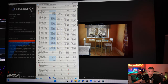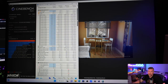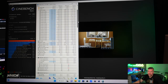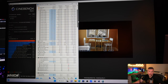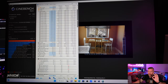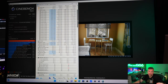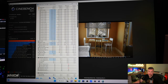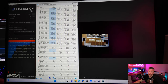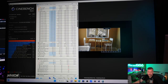The XMG Neo 17, I don't know if it can do that. Probably not quite, probably more like 140, I think, is what they've said in their documentation, because it just thermal throttles at that point. They don't have as many heat pipes as this guy. And that's with liquid cooling. On air cooling, I think it's 120 for the XMG Neo. More testing needed, not official numbers. The Alienware M16 was able to do about 165 continuously before thermal throttling at like 95, 99 degrees pretty consistently. And that was without any undervolt. So if you undervolted that sucker, I'm pretty sure the Alienware is going to do some really crazy numbers.